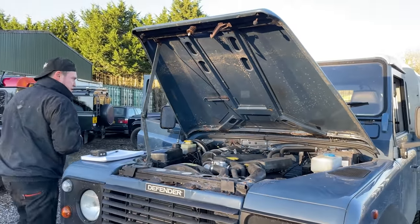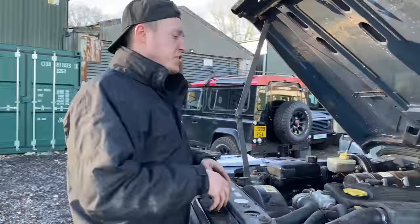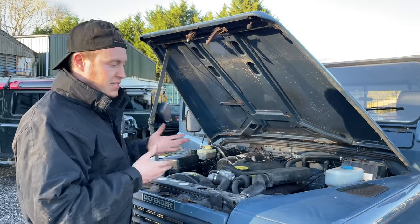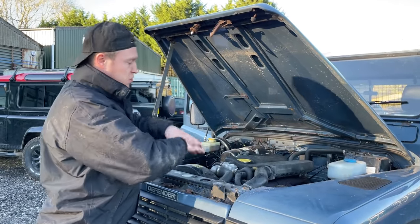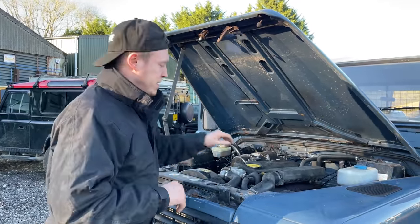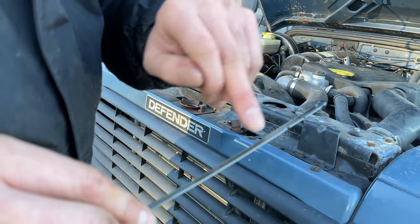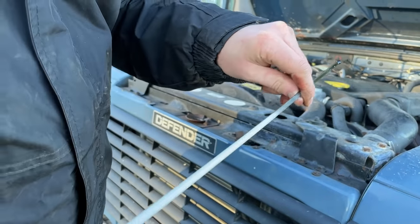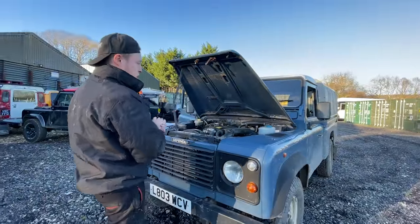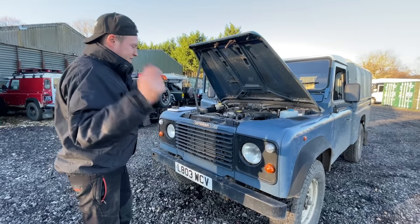Leave the bonnet up, start the engine and just listen for anything. You should be able to get a good idea of how the engine sounds - if anything sounds obviously knocking or banging. You can hear a squeaking from that tensioner, which is a very minor issue on these 300 TDIs. It's that front belt tensioner, and I'm not concerned about that. Checking the engine oil level - you can see the engine oil is almost translucent, almost clear, which is almost unheard of on a diesel. This has obviously been well maintained. There's no weird hoses or odd wiring going on - everything is original.